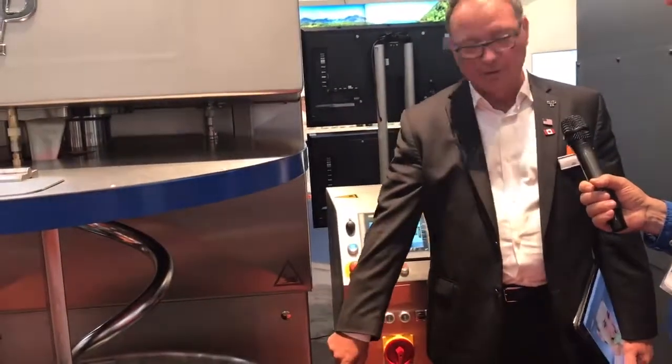And so the biggest concern I would have is the sensors then. When we were washing some of our removable bowls, sometimes switches would just rust out or something like that. Have you found your system to be very reliable? Yes, it's absolutely reliable. It actually is a hydraulic lock that's in there. So there's not just a small pressure switch that you're pushing it into, which of course are the things that get oxidation and any problems. This is a hydraulic lock. When you push it in, it fully locks in place, and the sensor that's actually saying the bowl is in there is inside of the machine. So it's not a little thing on the bottom.